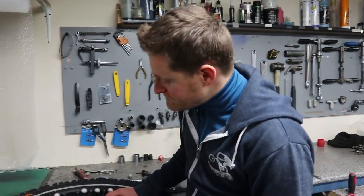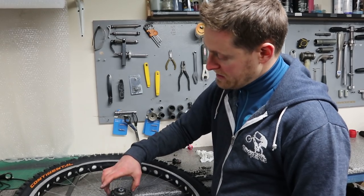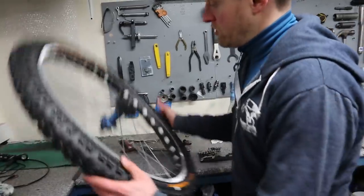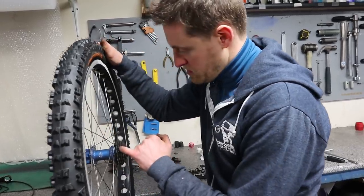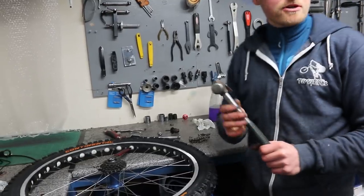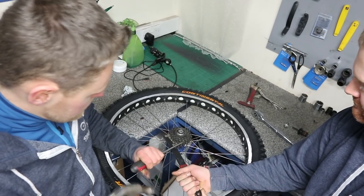We've got the classic trials problem: even though the sprockets are pinned together with three pins, when you put so much torque through one of the sprockets the pin can actually break and that sprocket digs right into the freehub body. We need to try and get it off somehow — if you just whack it backwards the freehub body spins. We'll look at the teeth to find out which one has been used most, as that's the one likely dug in. It seems to be the second one, so we'll hold the freehub and tap it the other way.